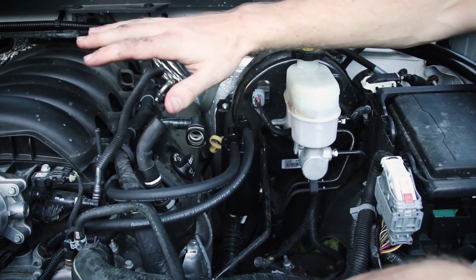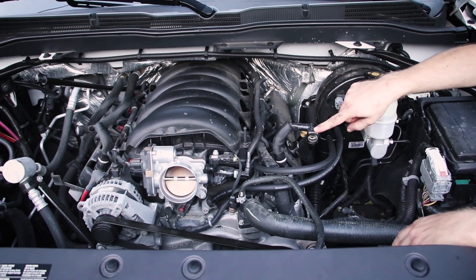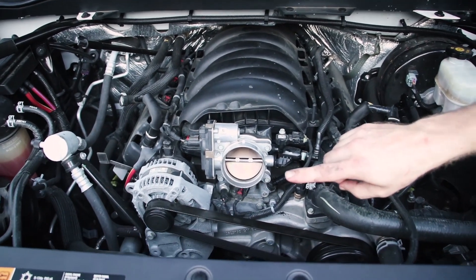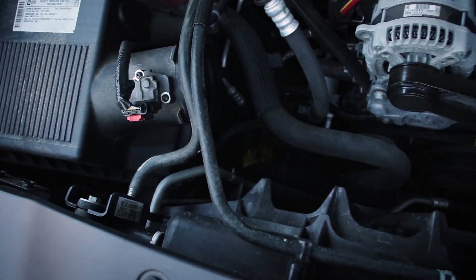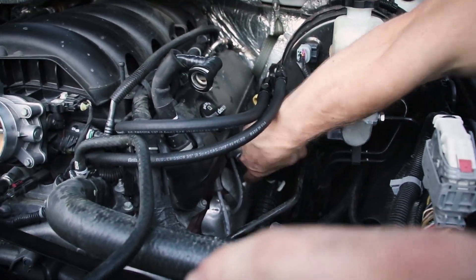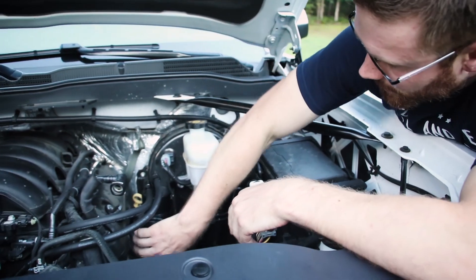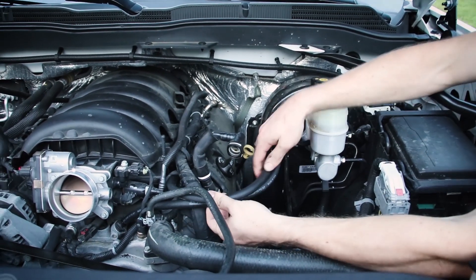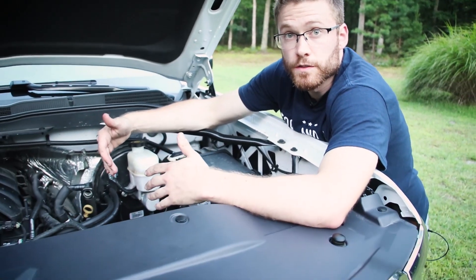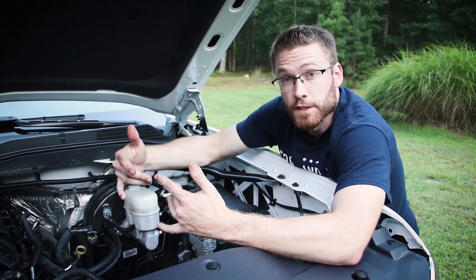Now go ahead and reinstall your air intake — install these two tabs right here, then reinstall the air intake with the two plugs and the hose clamp on the throttle body and on the air box on the passenger side. That's it. Here's the catch can installed — as you can see, it's very accessible. You can reach right down here and loosen this very easily, and have plenty of room to remove it and dump it. As the last step, I'm going to zip tie these two lines together. It's a very simple, straightforward install. We're going to be doing some follow-up videos showing how much oil is collected with the 5.3 liter Ecotech — so stay tuned for that. Thanks for watching guys!